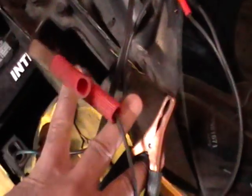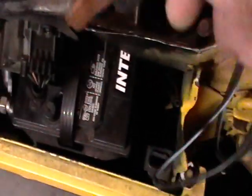I've made myself a pair of baby jumper cables. This is made out of an old timing light that didn't work anymore, so I went ahead and cut the cords off of it and put little ends on one end and the other ones that look like jumper cables on the other end. It just gives me a better way to test the battery — more wire, easier testing. So we're getting ready to hook this up right now.